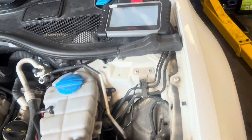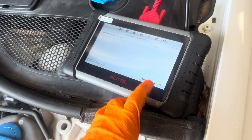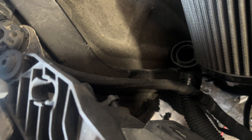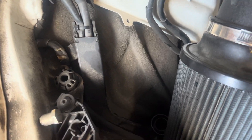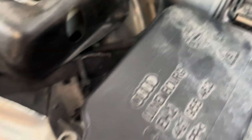We started it and commanded the pump on — there should be some vacuum and you should hear it turn on like a mattress pump. The fact that we commanded it on and nothing is coming out is indicative that the pump has either stopped working or the relay has. We checked the relay and you can hear it clicking — click click click click — activating on and off. So the circuit does have control over it, meaning the issue is with the pump itself.